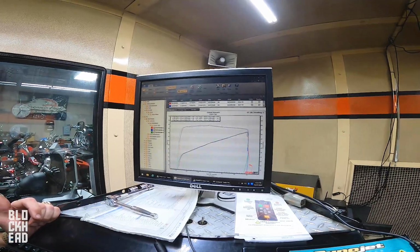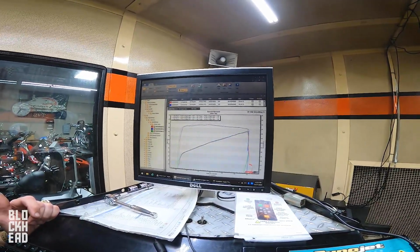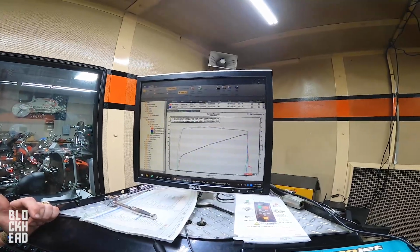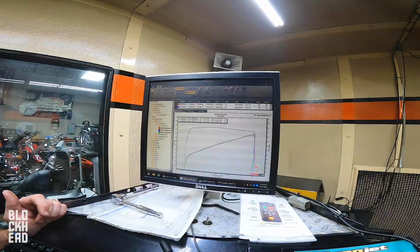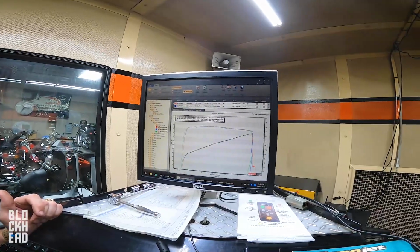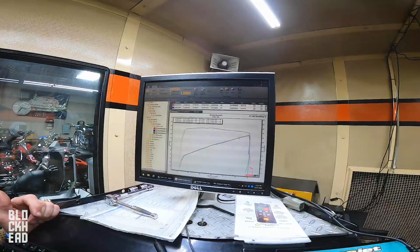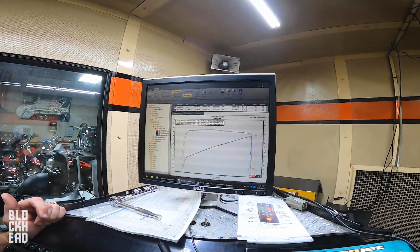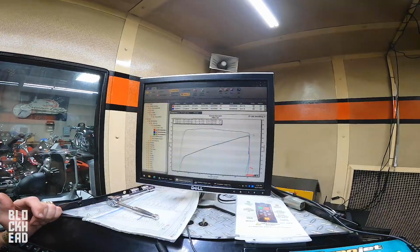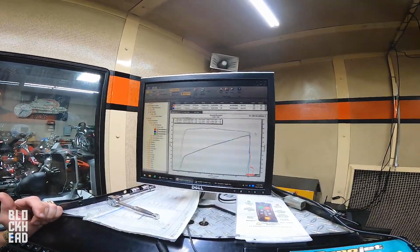Nice and strong through the center. This is your horsepower line. It looks a little backwards here because we're under 5,000. Anytime we're under 5,000, torque reigns, and torque is your baby right through here. So if a guy has a 5,000 RPM motorcycle and is bragging about all the horsepower they make, what, you're bragging about this part? It never crosses. They cross at 5252. That's a constant in the formula for horsepower and torque. The 5252 is in both formulas, and they are equal when they get there.